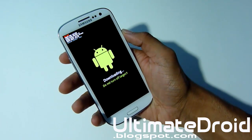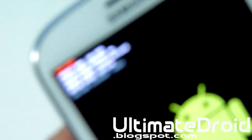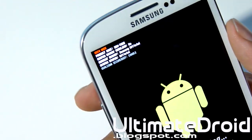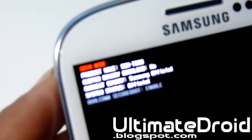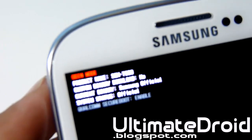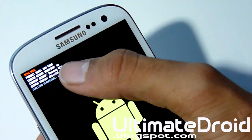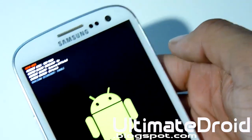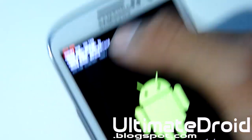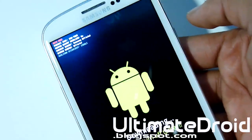I've entered my phone into download mode. Don't worry if you don't know how to enter download mode — you can also check using the app that we're going to get rid of. Right here, as you can see if you enter your phone in download mode, with the app you can also tell if you have a binary counter or not. But right there, mine says custom binary download: no. So that means I don't have any custom binary download, meaning I never rooted my phone or installed ClockworkMod Recovery or anything on my phone. But I actually did.